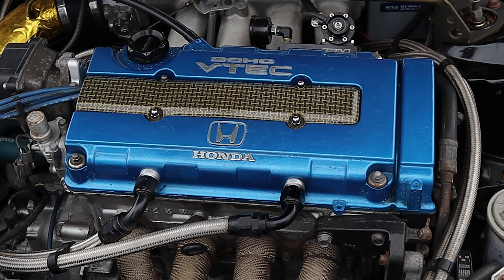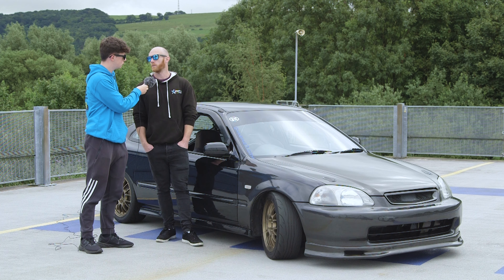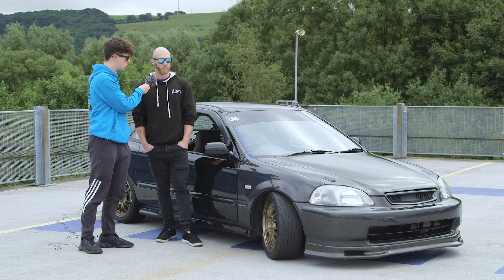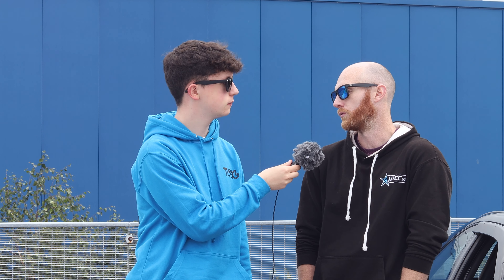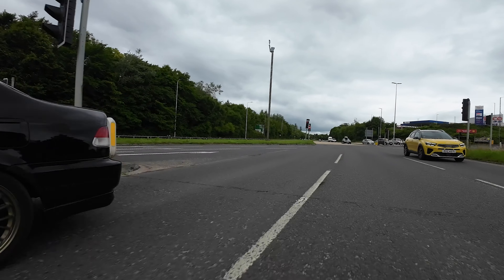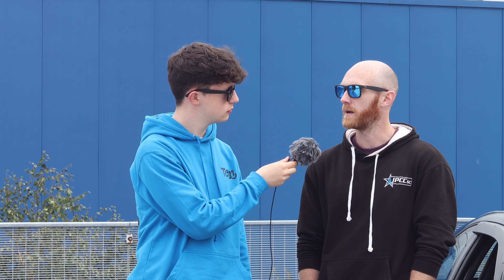At the moment it's just under 220 at the crank. When we were tuning on the dyno it started to run out of injector duty — maxing the injectors out. I've got new bigger injectors, a new fuel rail, and pressure regulators ready to go. From the research I'd done, it should do high 230s — some people in America said 240, but there are a lot of variables. An extra 10 to 15 horsepower would only help, so we'll get it retuned hopefully this year.